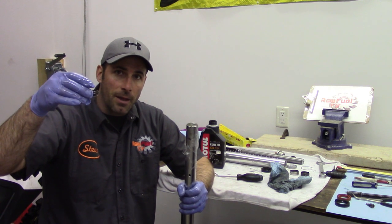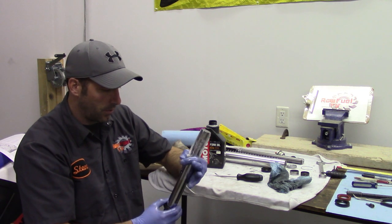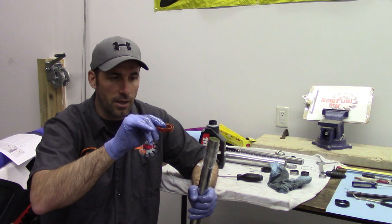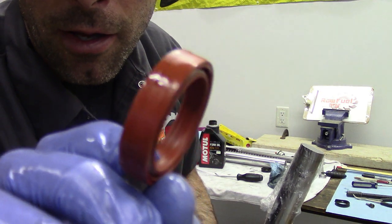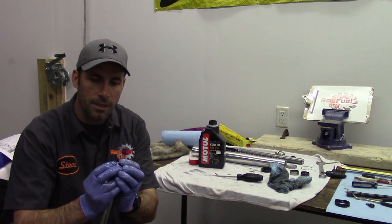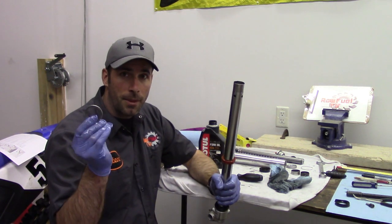Make sure you have these in the right order. The first thing is our dust cap — that has to go on. Just gently rock it down and as we push down you'll see it'll slide right the way over. Next piece is our brand new seal. You have to know which way the seal goes — it's got a slight taper to it, and there's a deeper side of the seal itself. The shallow side is going to go down with the deep side facing up to catch the oil. Lightly push that on, make sure it goes over the ridge nicely. Now that we've got both the seals on, we're going to remove the cling wrap and put it in the garbage.